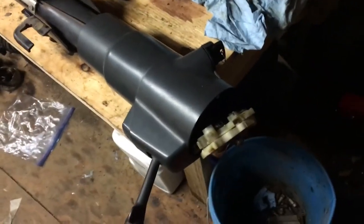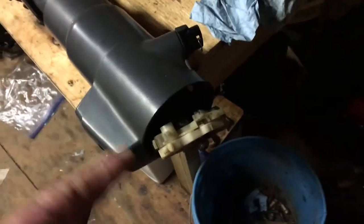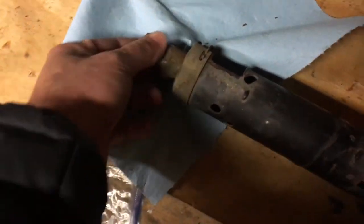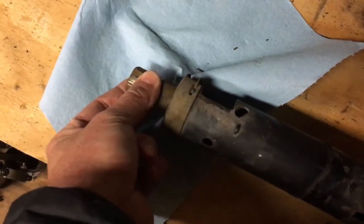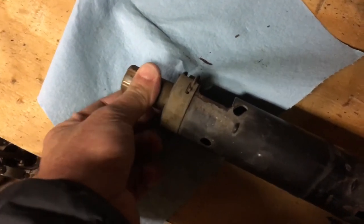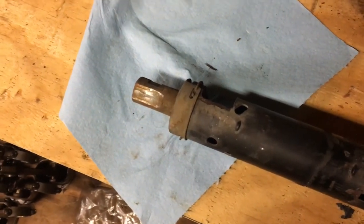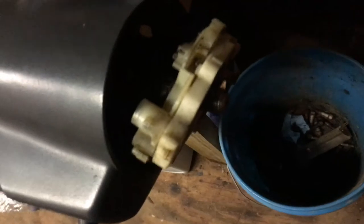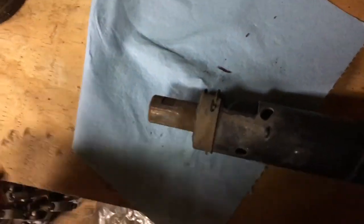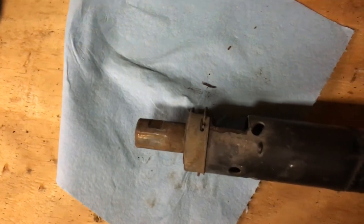At this stage I've repaired the steering column and I'm going to put it back in the vehicle, reassemble all this together including the steering wheel, and put it back in the car because I need the steering wheel. In order to line up, there's some kind of a clamp — almost like a U-joint — that fits back on here. That clamp has jaws that squeeze on here, and in order to get it back on, I've got to rotate this steering shaft to get it in the right spot. I don't think the tires will be pointed straight when I do that. So once I get this on there and use the steering wheel to turn the wheels in the straight forward direction, I will remove the steering wheel and put it back on oriented level with the front wheels and straight ahead.